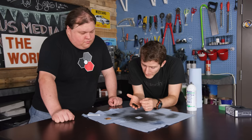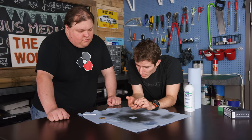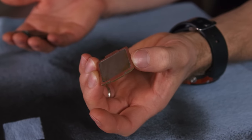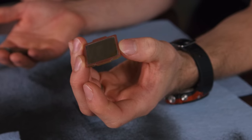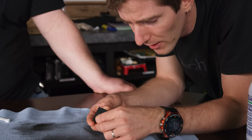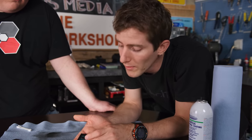So something we didn't account for in the original plan was the extra thickness that would be added by the plasti-dip. So a quick extra step we had to add was sanding down the bottom of the IHS a little bit to account for that clearance, because it's the glue that we're gonna apply around the edges when we relid it that's gonna hold it on. So that's sort of important. So now all that's left is to peel this off, exposing our die. Liquid metal the die.